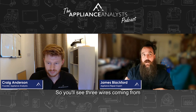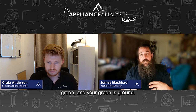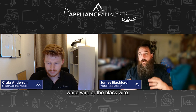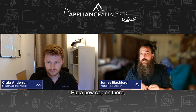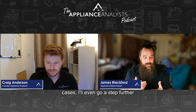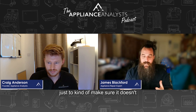So you'll see three wires coming from your household power and three wires that are part of your dishwasher wire harness. There's a white, a black, and a green. Your green is ground, that's typically good to go. Usually it's either the white wire or the black wire. You'll just see it's blackened. So if you just remove that cap, clean it up, put a new cap on there, you're usually golden. What I like to do in those cases, I'll go a step further and wrap a bunch of electrical tape around each of those connections just to make sure it doesn't happen again.